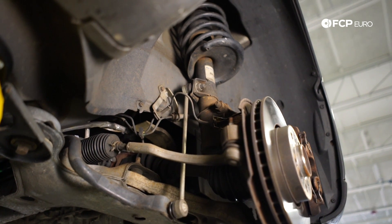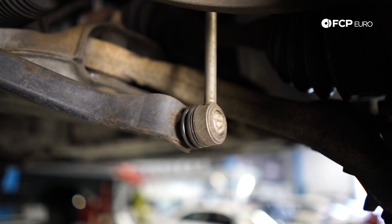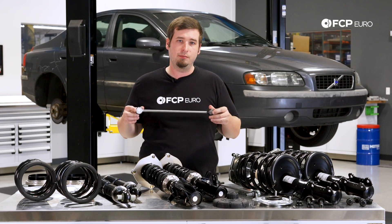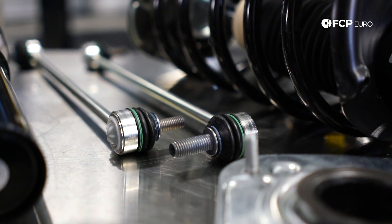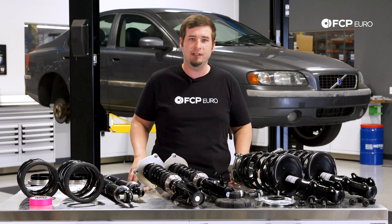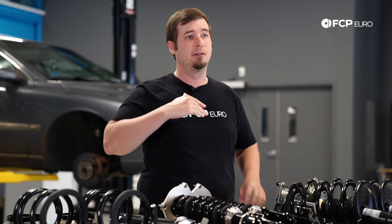Starting at the front end, you're not going to come across any surprises, because this is a basic McPherson strut assembly. All the typical things that signal a bad strut translate here. One of the most common, as well as one of the most incorrectly diagnosed front end failures, actually deals with these sway bar end links. The sway bar end link is basically a connection between the sway bar and your strut. It has a ball joint on each side and is under a lot of tension. When they go bad, you're going to get a noticeable knocking sound when going over road imperfections — it kind of sounds like a loose washer fluid reservoir stumping around in the front. When you change these, make sure to jack up both sides of the car to relieve the tension on the sway bar, or else you're going to have a lot of trouble removing them.